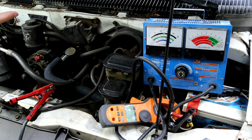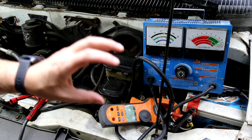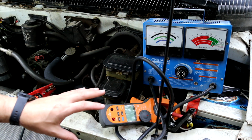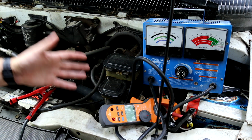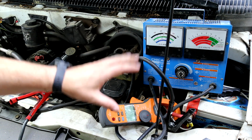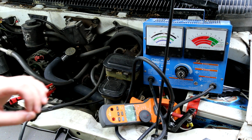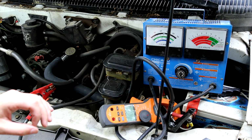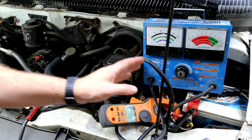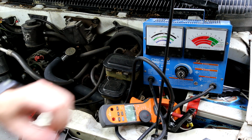No, it is not. The intent of this system was to have the bulk of the charging amperage go to the back. The front is just for normal vehicle function. So 4 gauge was a good upgrade from the very old 1994 8 gauge that was in there, just to keep the vehicle running smoothly. I am not going to get 370 amps of current through that 4 gauge wire, so that is going to be a consideration for this particular test.